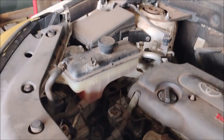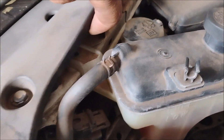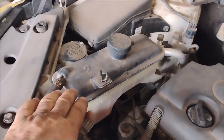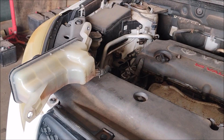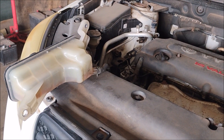The first tip is this coolant reservoir here, which has a retaining bolt right under here with a 10mm head. Just get this out of the way. I've unfastened the coolant reservoir and I've just swung it over the front of the car.